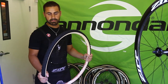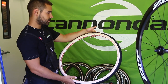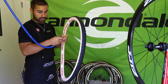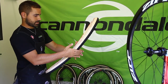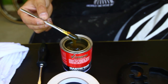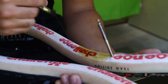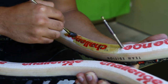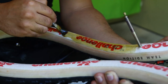After finishing the first layer on the rim it's time to move on to the first layer on the tire. I'm gluing up a Challenge Limus. I start by inflating it up so I can hold it in a figure-eight pattern — doesn't need a ton of air, just enough to keep its shape. I start right at the valve, nice even layer. You don't want to make it too thick or chunky, keep it pretty light. As you go it will dry up and soak into the base tape. Very important to get all the way from one side to the other — don't leave any bare areas.